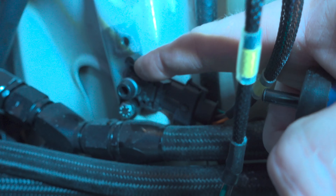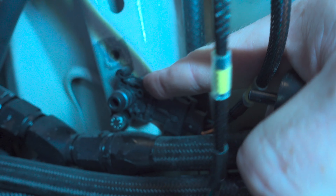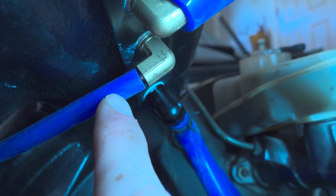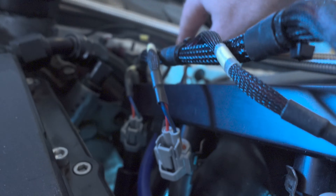Moving down the line in the center, the other 3/8 inch connection goes right here — it's currently disconnected but it's going to the IMAP sensor, which the engine needs to figure out how much vacuum is currently in the intake so it can do proper calculations. I've bolted mine to the side over here, and I'll plug it in manually and put a little clamp over it. Other people have put the IMAP sensor elsewhere, but I have these screw holes, it's tightened down, and it's not going anywhere.